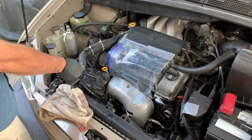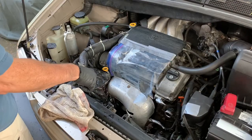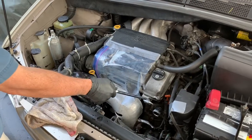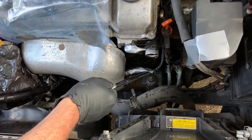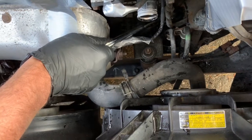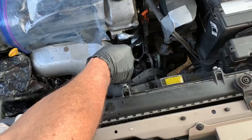Now I'm going to protect my engine from water splashing around. First up, I'll put a black bag across the alternator and tape it to the sides. Then a clear plastic bag across the spark plugs. Down there you can see another electrical connector — I put some tape over that; duct tape works fine. Just below that there's another connector that I've undone and I put a bottle cap or plastic cap over that.